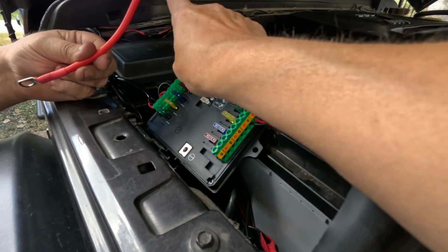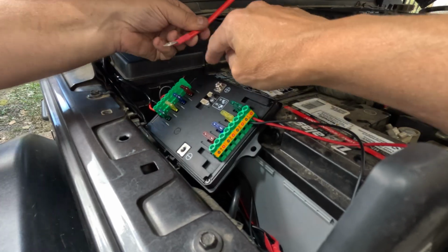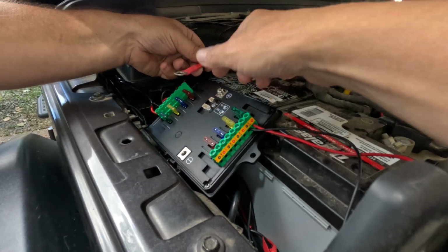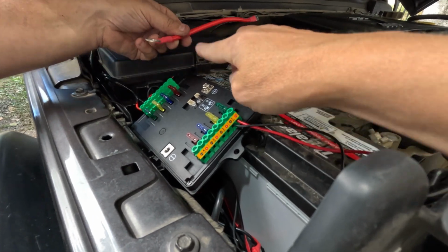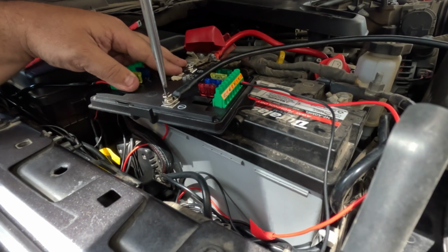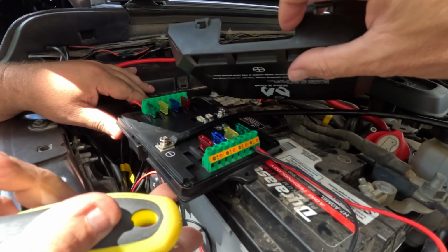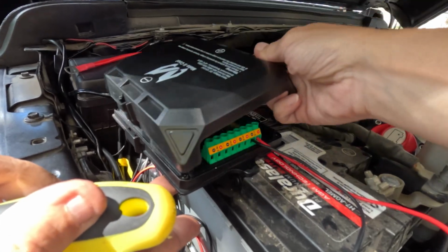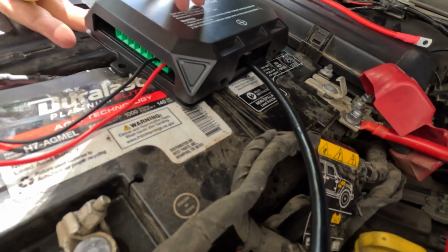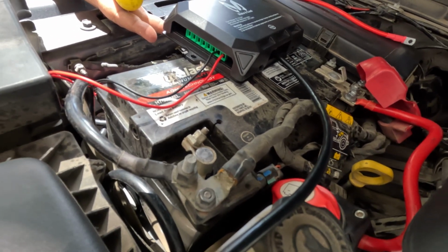That wire, battery wire, was not long enough, so we flipped them and had to flip everything over, so this was on the top side. And we made these wires a little too short to just be able to turn it over. So those are on 5, 6, and 7, and then the rock lights are going to be on 1. This will go to the hot, and then you've got one to go to the ground. There's an opening on this side that your power and ground wires will run out of. So it'll look like that coming out of the box. So make sure you know which direction your lid is setting so that you can run those out appropriately.